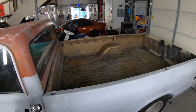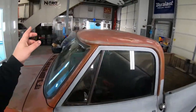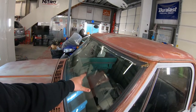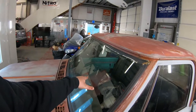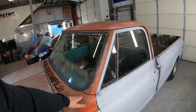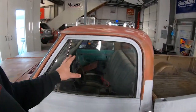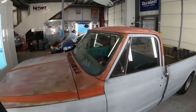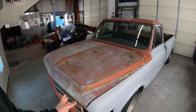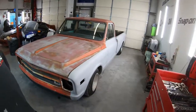So like I said, satin hot rod black on the entire exterior. We're going to do Raptor Liner bed liner on the inside of the bed, get the entire inside painted. We still only have one door panel — we'll probably do a different color on the interior steel door panel, but once we get the other one we still need a steering wheel. We have brand new rubber for the glass, and we're going to get brand new rubber for the door inner and window tracks. All the trim is polished up — windshield wipers, emblems — and we've got brand new lenses and lights for all the lighting.